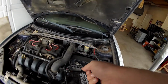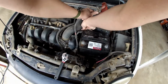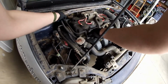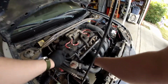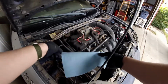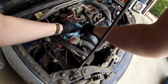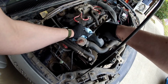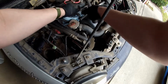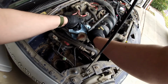Put the battery back in. Doubt there'll be anything here, but let's see. You need to flush the fuel line. The Neon has one pressure line and a vent line, so fuel only circulates inside the pump. I'll worry about cleaning and replacing the injectors later. I captured the fuel and dumped it in with the rest of the questionable fuel that I saved from the tank. As expected.